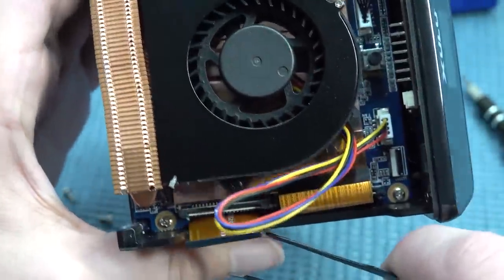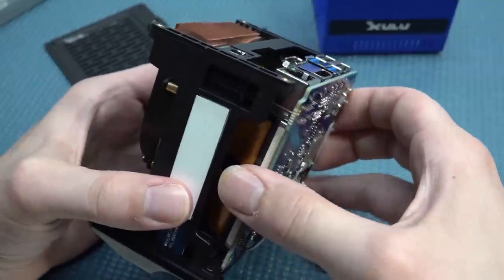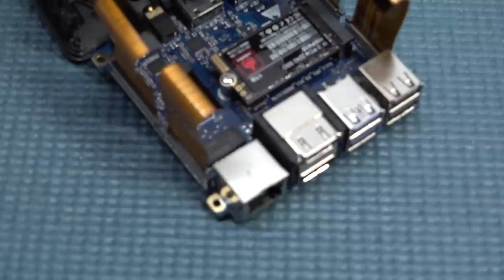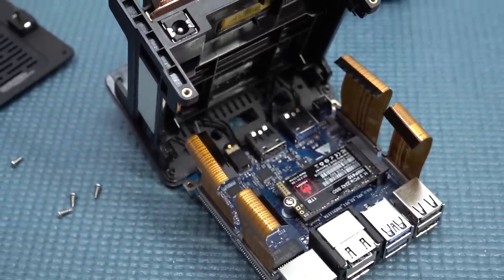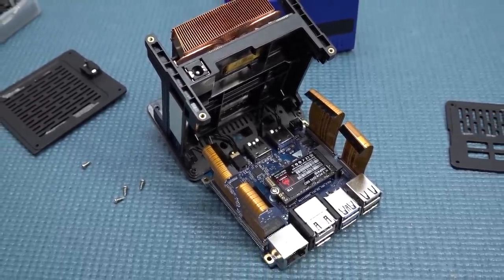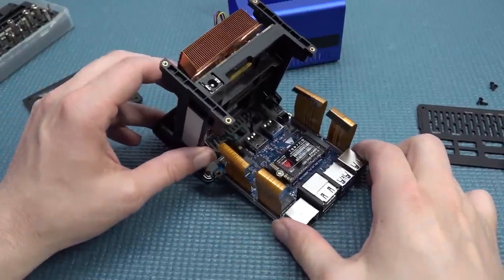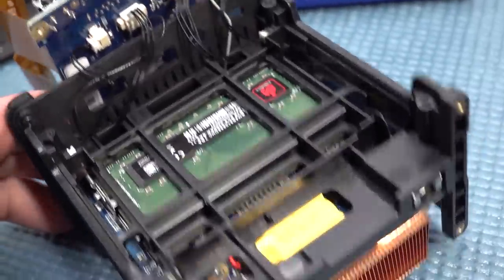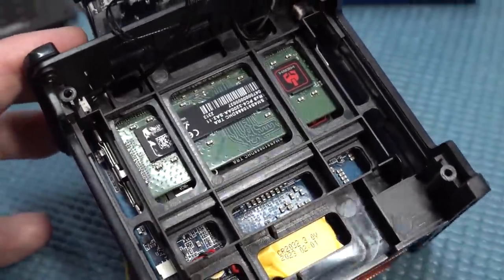So you need to get all of the ribbon cables loose, then we're going to get basically a disassembly of the system itself. Here we can see the bottom part can be removed, and there is the SSD. So it's absolutely a lot of misery to rip this thing all apart if you want to replace it. Another thing is, because of the compact size, there is no way of adding a second storage capacity like we have on some other devices. So, a couple of things that you need to take into consideration. And yeah, I think also when it comes to the RAM, same thing, you just need to remove the full thing. At the top part, there we're going to find the RAM, but everything is so difficult to reach.